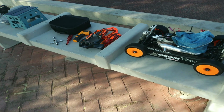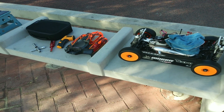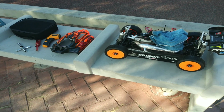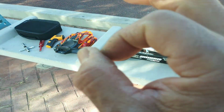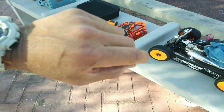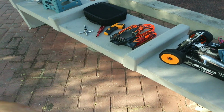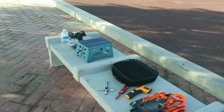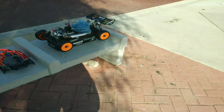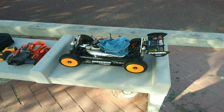These reds, and I will tell you, the good thing about modded motors is once you get them dialed in. Reds can be real finicky and touchy, not as much as a Pico, which means they're very sensitive to the adjustments. So you got to make sure you're making small adjustments. When I say 5 minutes on a watch, that's 5 minutes, slight turns. For those of you used to making 30-minute or hour turns, if you do that on a lot of these Italian motors, Novarossis, Picos, Reds, you're going to be going back and forth a lot, man, and getting frustrated.